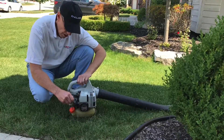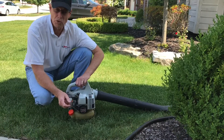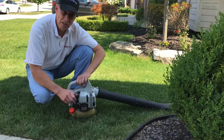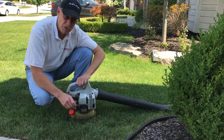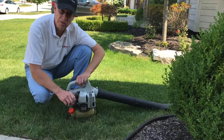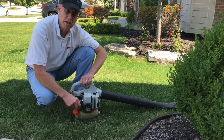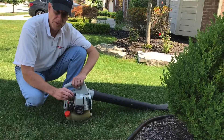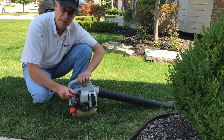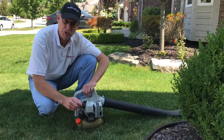As an example, if I tune this carburetor today and the temperature goes up tomorrow, it will run richer. If we tune it today and the temperature drops tomorrow, it'll run leaner. So as the temperature goes down, the carburetor will lean itself out. The way I typically tune is with a little bit of insurance — I'll look for a peak RPM but then back it off a little bit in case the temperature drops.